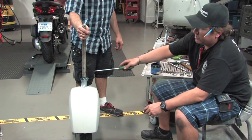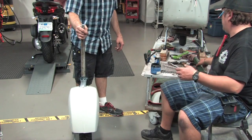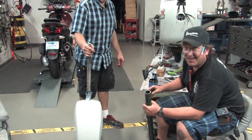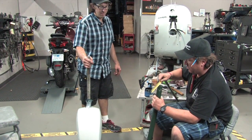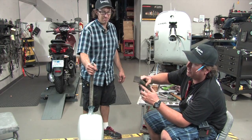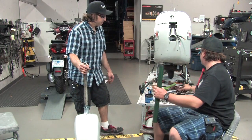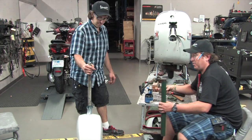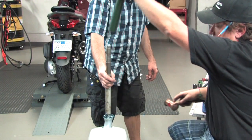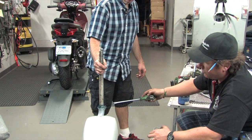In order to install the grease cup, it commonly just drops down, but there is an interference fit between the lower race and the cast aluminum knuckle. We've got a little homemade tool — the inside diameter is about 1-3/8 inches, cut to rough length with a plate welded on the back side. It's tall enough that you can take a good-sized hammer and drive the race on. Normally you'd do this without the cables in there — it would slide down and you'd tap it until the race bottoms out. We've jumped the gun and packed this lower grease cup with our shop grease already.